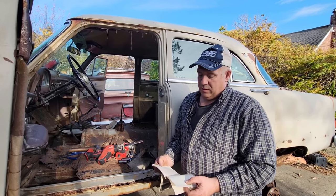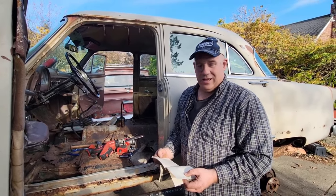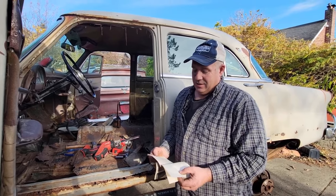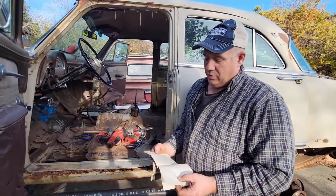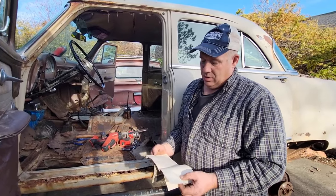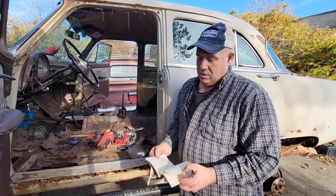Took carburetor off, completely cleaned it. Blew out jets with jet air. I wonder what the hell he means, jet air. Probably some cheap cleaner. Changed oil, put in 10-40 Ward Supreme. Do not put in any other oil. It's like he's giving instructions.